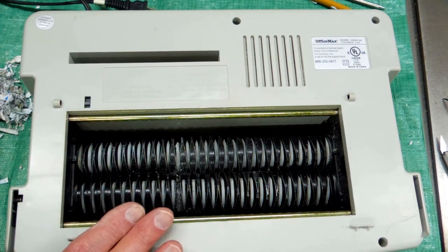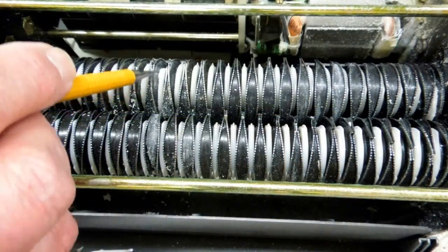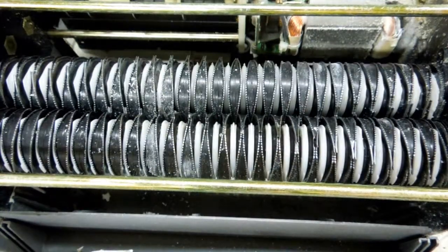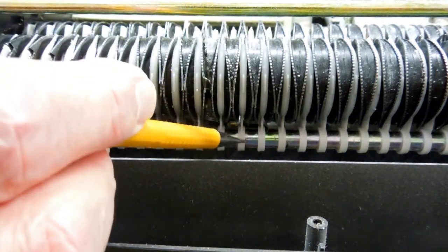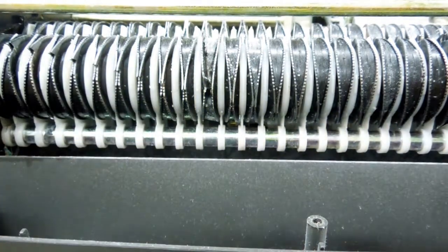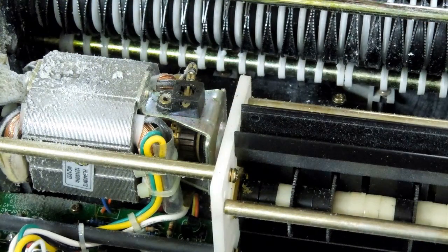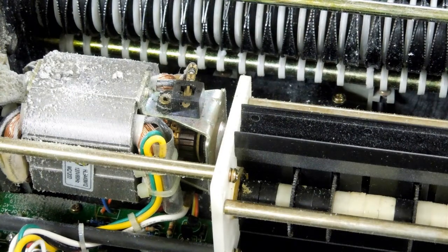Now that I know for sure it's not worthwhile trying to repair this, this thing weighs a little over nine pounds and we're going to look inside and see how it's made. When I run this, you'll see that this piece is turning and the other pieces of white nylon are not. And the reason it's not turning — each of these pieces of white plastic are supposed to be attached to this ring that's being held stationary by this bar. We can see a piece of nylon over here that's supposed to be attached to this nylon spacer, and this one that was supposed to be attached to this — both of those have broken off.